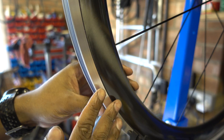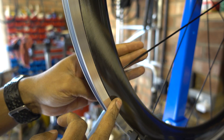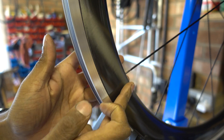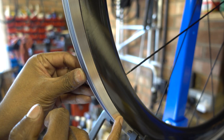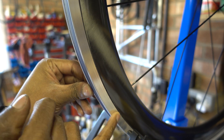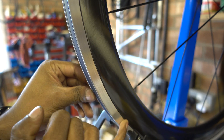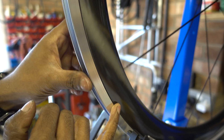I've put the wheel in my wheel truing stand to show you some of the manufacturing oddities. The spokes are bladed — nothing new in that — and the nipples are behind the rim tape so you can't see them. This aerofoil profile has been around for a long time; people say it's old and therefore rubbish, but I tend to disagree. The machining quality on the braking track is not great. Machining aluminium is not straightforward because the material tends to gall, but the bridge between the brake track and the dished shape of the wheel isn't up to Shimano's best quality control — especially for a Dura-Ace wheelset. When you run your finger over it, it feels quite rough.